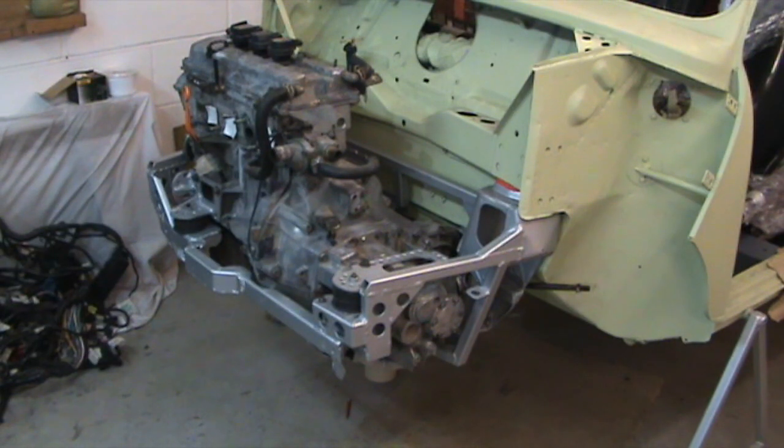The main event this evening was to get the engine subframe back in the car - very, very easy to do, in fact. I found the easiest way was to suspend the engine in an engine hoist and then sort of thread the subframe on. It's very useful if you've got something to help you do this. You can easily thread the subframe on around the engine and gearbox, fit the mounts, bolt it all up and it becomes one piece. Then I just used a trolley jack underneath the engine and gearbox, lifted it up to the car, jacked it into position, put the bolts in, and that was essentially fitted. Just put the floor mounts in and that's good to go.